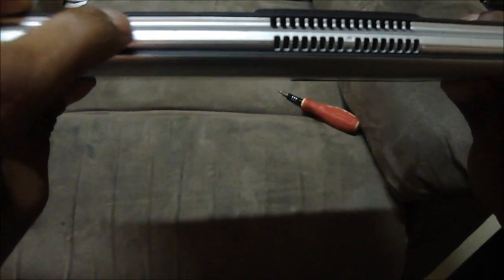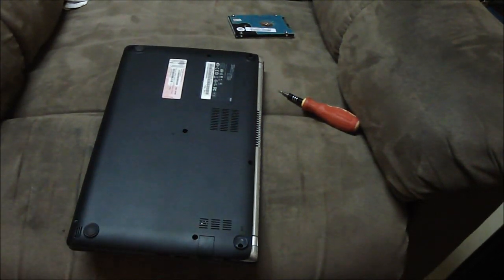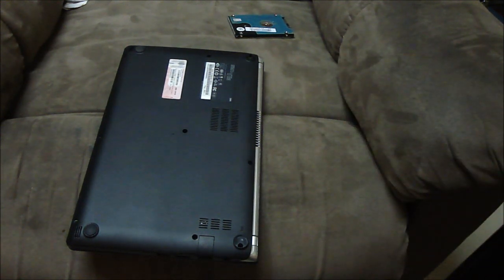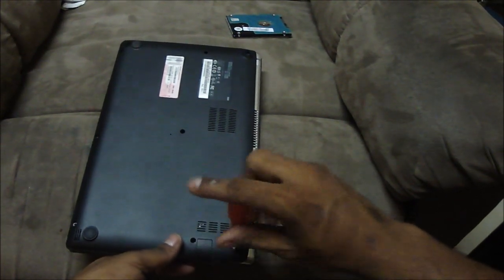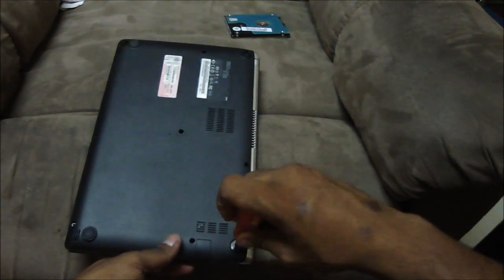If you can see, no damage done to the ultrabook. You cannot see any of the markings apart from a few over here — that's because I was experimenting finding a way to pop it out easier. If you follow this tutorial you should not see any markings at all. Now it's time to put these nine screws back in. If you're paranoid and want to see if you've done the job right, you can go ahead and turn the ultrabook back on before you screw these into place — so in case the drive is not seated properly, you don't have to unscrew everything again.